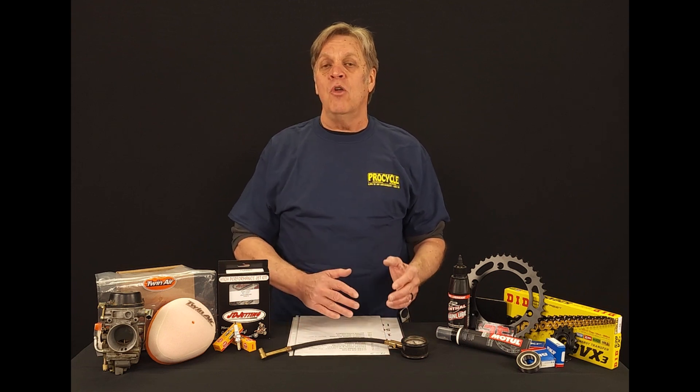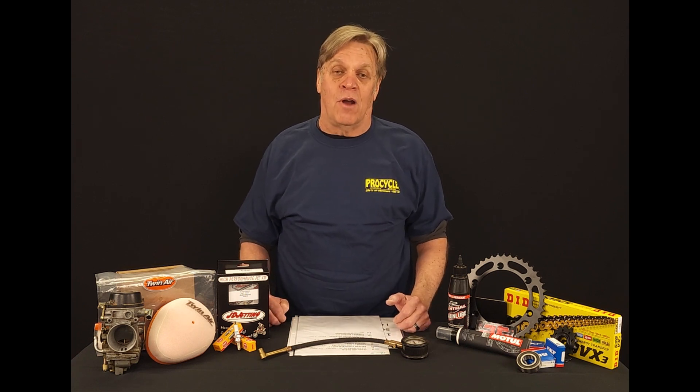Other things that don't include the bike but hurt miles per gallon: luggage packed out real wide just becomes a big sail and slows you down, which hurts miles per gallon. Sometimes that's the only way to carry luggage, but if you can streamline it or put it in bags, that definitely helps. Riding style can also hamper miles per gallon — there are really no trophies at the next signal, so grabbing a lot of gas continuously hurts miles per gallon.